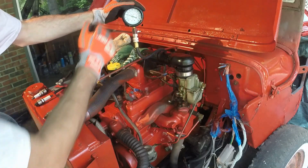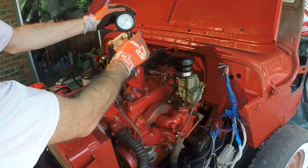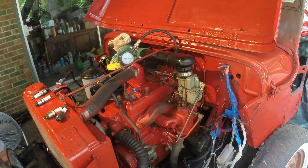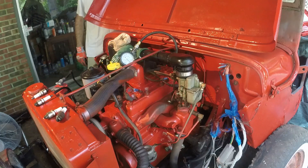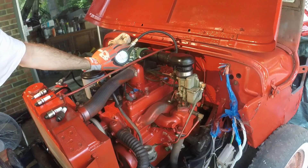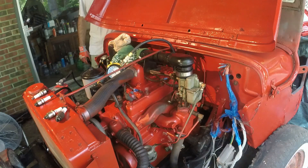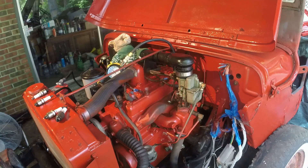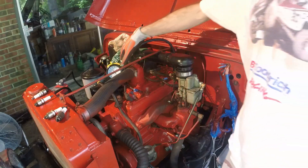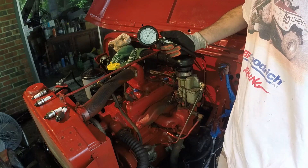Specs are 90 to 100, so it's obviously a little bit low, but it should run at 75 PSI. We've got number four hooked up and it only reads 60. Perhaps I didn't get it tight — we're going to check it all out. We're going to try number four again and it's still reading about 60, so I guess that one might be a little low. Not sure what's going on with that particular one. That may be part of the trouble.